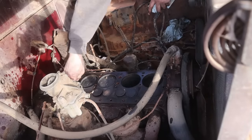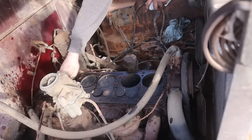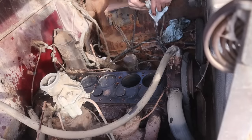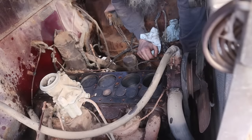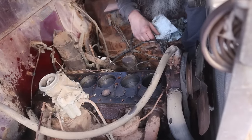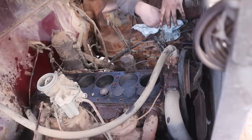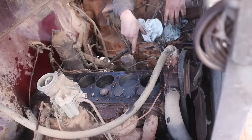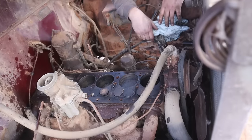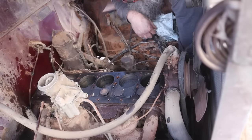Oh, this valve is not seating at all, so something's a bit fishy there. That would have had no compression. Now we can check backlash in the cam chain. Oh, I can't turn it the other way. Okay, I think it's gonna need a timing chain. If you can move the crankshaft like 20 degrees and the distributor rotor doesn't move, then the valve timing is just poo-poo. It just means we're not getting it run until we've got that.